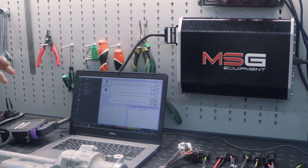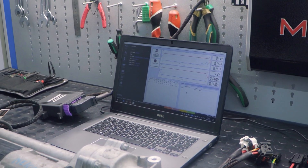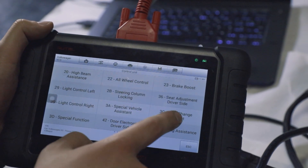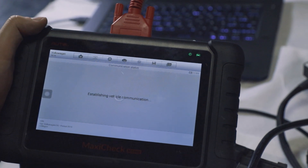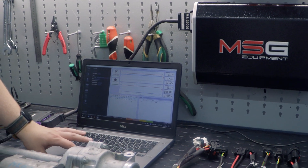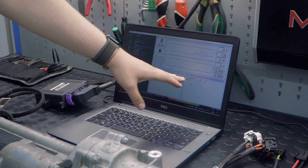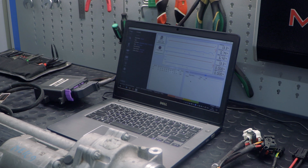To perform additional diagnostics of the rack, for example to check the error codes, we are using a diagnostic scanner — any diagnostic scanner which is compatible with OBD2 protocol, because we have it in the controller. Also, here in the program we can see how the torque sensor shows us the signal. It's like an additional feature of the controller.